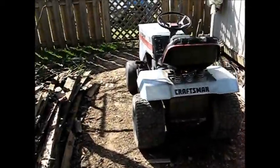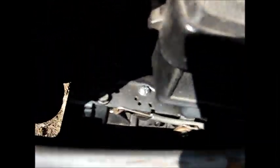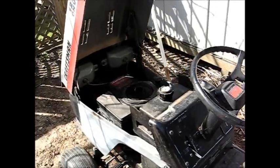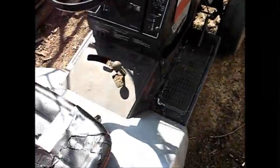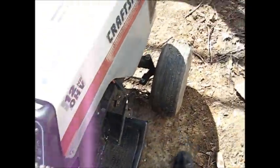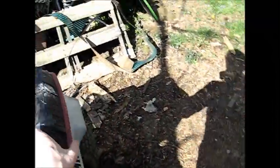The off-road mower — I did get it running. I actually did a separate choke so it works off that. It does work, but it needs some improvement, simply because the bolt there sticks down and it sticks on the throttle a little bit. I had to bend it up a bit — when I first started it up it was basically running wide open. Luckily it didn't rev high enough before I shut it off. The transmission is terrible, but it does shift better after I took it apart and put it back together. It has some bushings that probably need to be replaced because they're copper — basically nothing left. I do have plans for it, but it's not on my priority list.